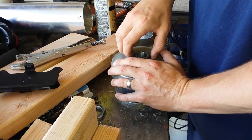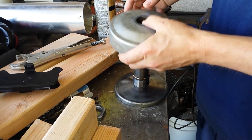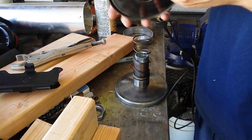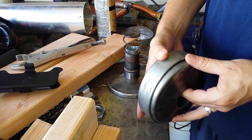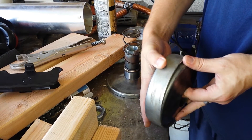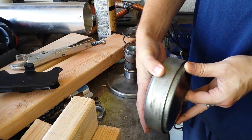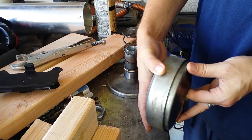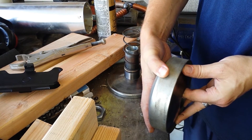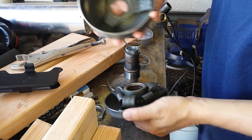If I give it a little bit of gas it will usually work fine, but you're supposed to clean these regularly. What's happening is it will not retract — it'll retract most of the way until it gets to about here, and then it likes to stick, basically keeping the belt engaged. Then you hear a click and it finally sucks in. So it's sticking.